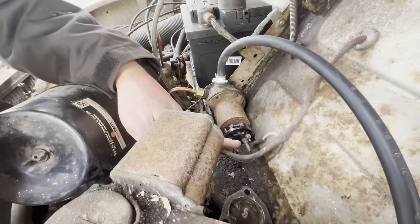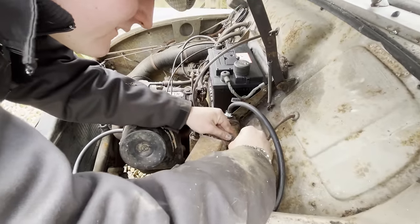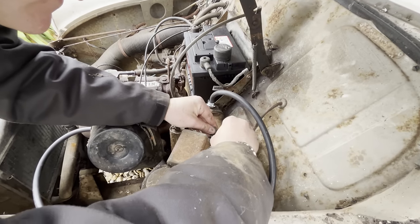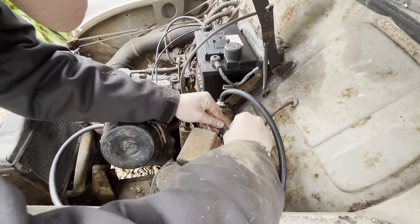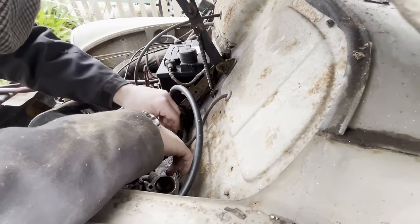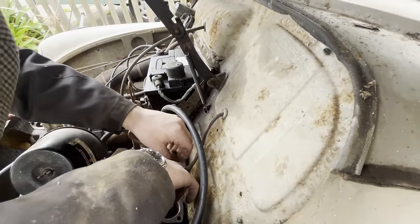Get a bit old and cruddy, I suppose. So give it a bit of a clean and see what we can find. Go for it. Right. And clean up this wire as well. This contact was a bit nasty. Years worth of damp, not anything any good. A little bit of emery, and then we've got a set of points on the back. Light points in the distributor. We need to make a connection, so I'm gonna run some emery between the two.